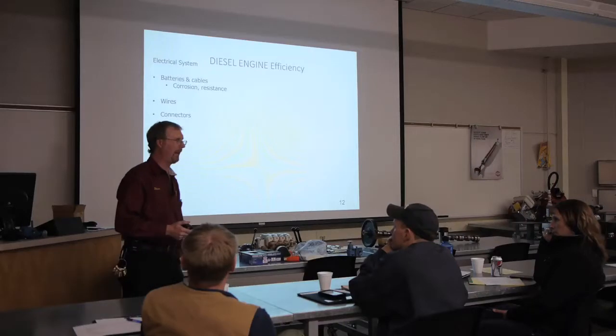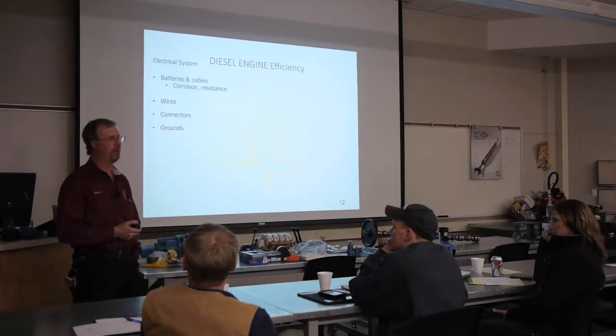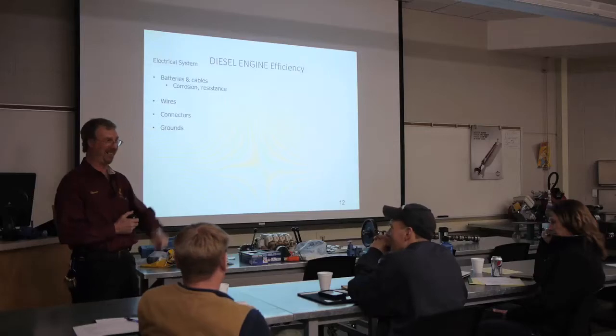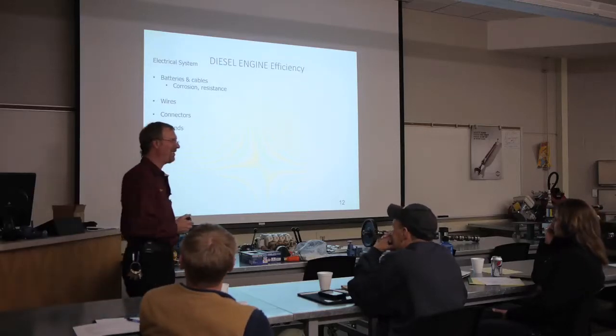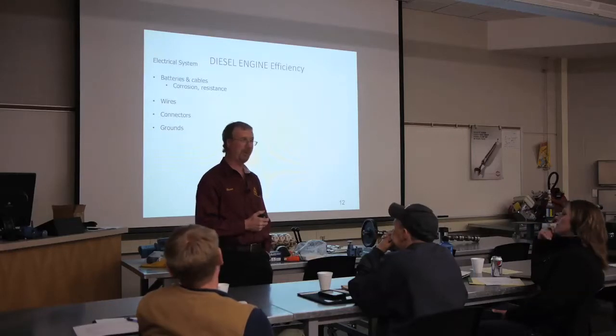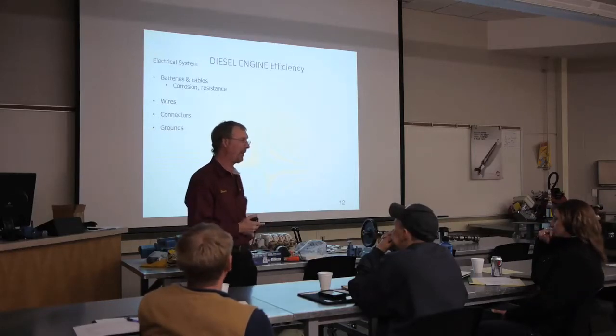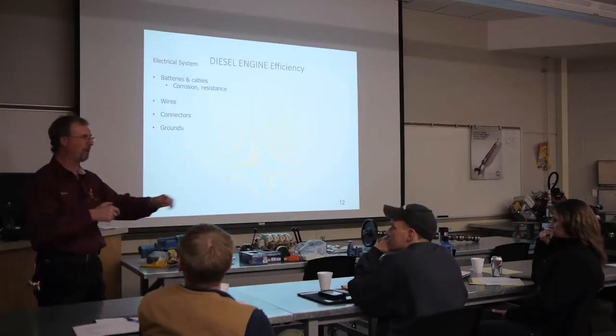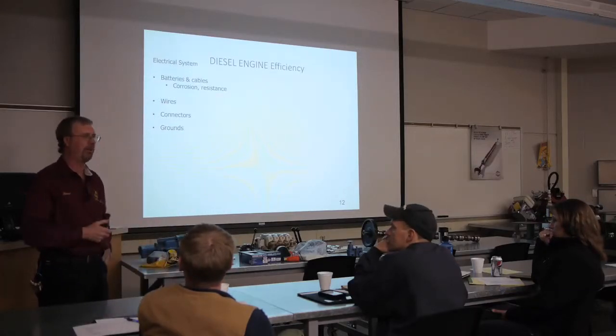Next day I pulled it out and I started looking at the grounds. And I had a quarter inch bolt that had 17 circuits. 17. I will never forget that. I thought, you are freaking kidding me. It was unbelievable. It doesn't have 17 on one ground now, I can assure you that. All right, so all we had to do was find some other good grounds and we split the circuits out and that took care of the problem.